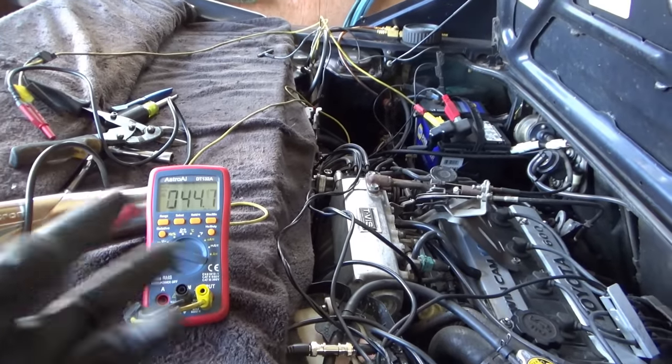Probably based on the vane airflow meter. During your diagnosis, it's always a good idea to pause, collect your tools, organize, regroup, and think: what did we just learn? What explains all these symptoms? I'm confident that at high idle or in the throttle range, we're basically at the max of that fuel trim table.